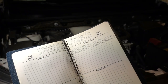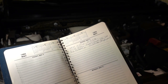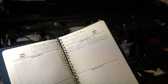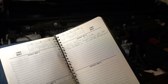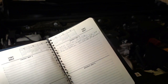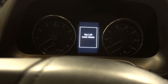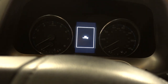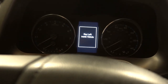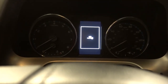Don't forget to update your maintenance log — this is my first operation on this car. Yesterday I checked the air filters and they were okay. This is the same book I used on the 98 Ford Contour; I just tore those pages out, but it's important to keep a maintenance log. Next thing you want to do is start it up and make sure the low oil light goes off in a few seconds. If it stays on too long, shut it down and see what the problem is. Once the oil light goes off, quickly run outside and get underneath with a flashlight to see if there's any oil leaking.